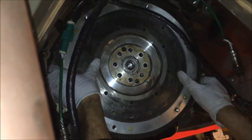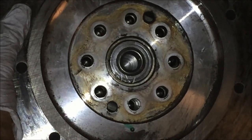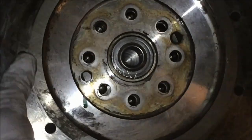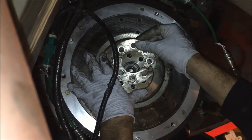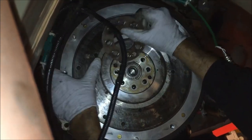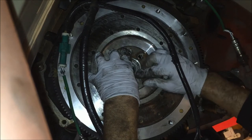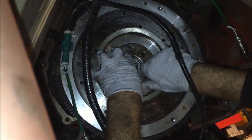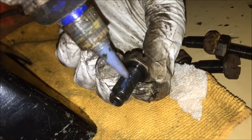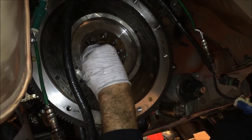As we're lifting the flywheel back on, you're going to want to spin it until all the holes line up. You can get it pretty close and still have one or two of those bolts off because these holes aren't all perfectly spaced. With the flywheel up, replace that other small disc that goes on the front of the flywheel and run in two flywheel bolts to hold everything on. Then we're going to put Loctite on all the flywheel bolts and start running them in using the star pattern, then tighten them down in a crisscross pattern.